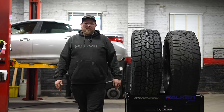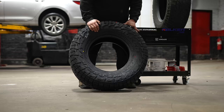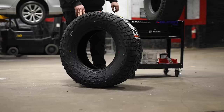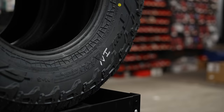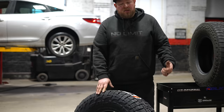The big difference on the AT4W is a much more aggressive sidewall lettering and a change in design around the bead area to eject water and debris. They've also kicked it up a notch on the ejectors for rocks and water — something the AT3 was lacking. They've also reinforced the sidewalls in material; it's called a Dura-Spec sidewall on the load range E and F models. This basically improves air-down capability so you can go to 10–15 PSI off-roading, and also while towing you can crank it up to 80 PSI — this tire handles both scenarios.